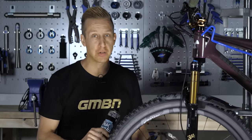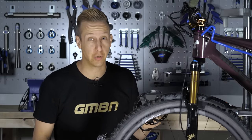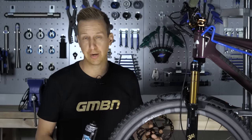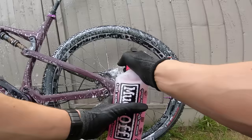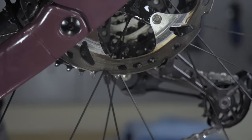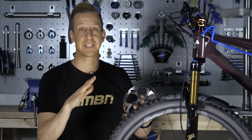Using the wrong cleaning products on your brakes. Ideally, you want to use as little cleaning products as possible near your braking rotor surfaces and on your brake pads — they do a pretty good job of self-cleaning when you ride, and often only need a bit of water. However, riding on roads you can pick up salts and lubricants from cars and other bikes, in which case you're going to need a dedicated brake cleaner. You won't beat proper disc brake cleaner, though most bike washers are fine to use around your brakes — but definitely check if unsure. At all costs, avoid waxes, any rag you clean your bike with near your brakes, and even your bare hands, as you have oils in your hands that can get onto those rotors and mess them right up.